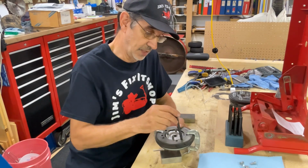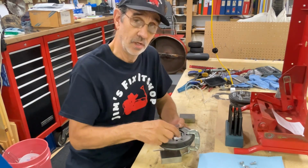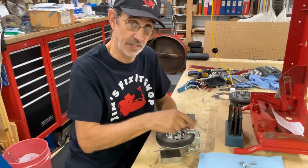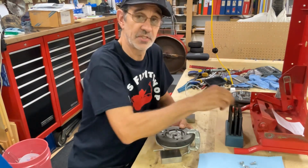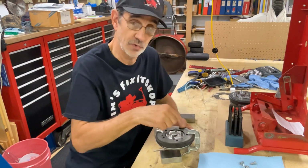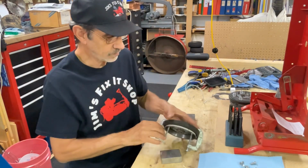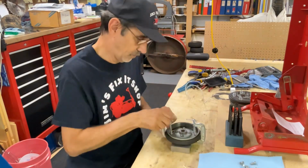And keep it straight and punch that. If it's sitting on here, it should hold it good enough if you got 3 clamps to punch them. That'll give your drill a place to start, so the drill isn't trying to walk around. Drill the holes. Then you can take this thing apart because they're not done yet.